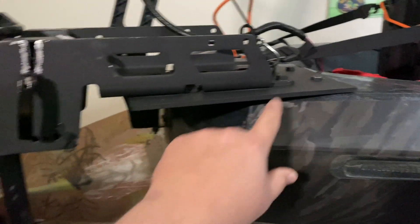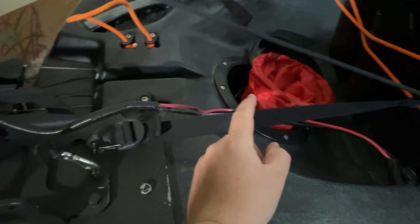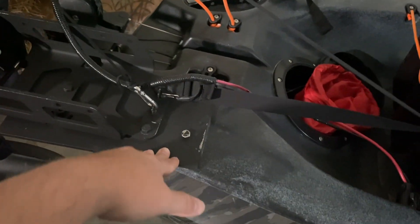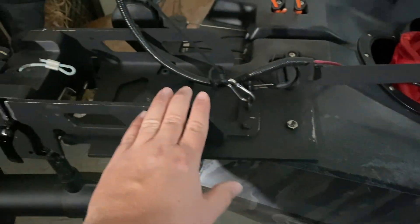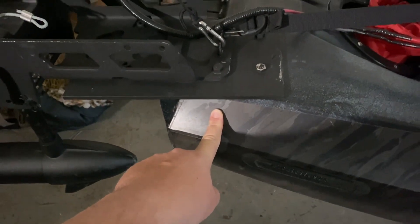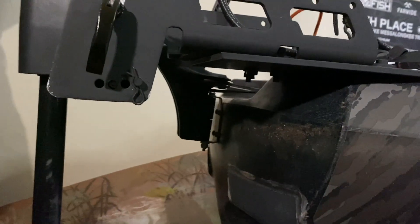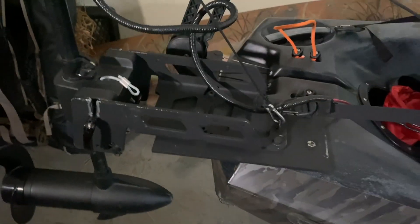The front four bolts go through another quarter-inch piece of aluminum. I had it shaped with cardboard to get the angle right around the kayak. I made a five-inch hole in the kayak — sealed and waterproofed — to get the backing plate underneath so the kayak doesn't flex under load. The front two bolts of the Newport Vessels mount go through the motor mount, through the aluminum, and through the backing plate.